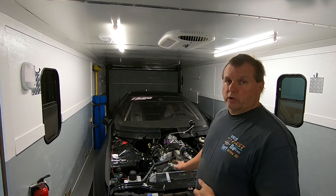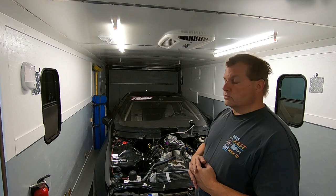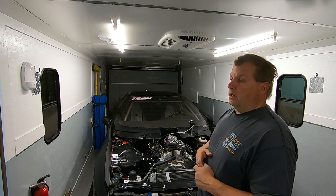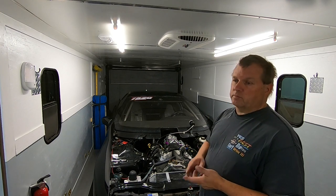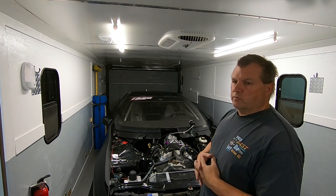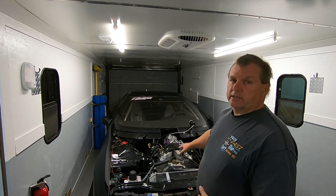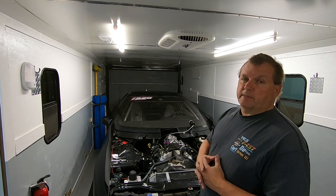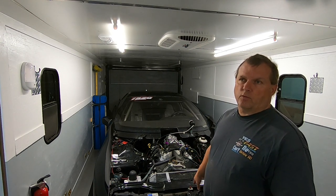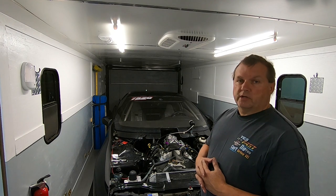Methanol is the way to go. So this carburetor, I'm going to go ahead and get rid of it — probably put it on the marketplace, go ahead and sell it and get some money back out of it and put it toward something else. It is an experiment, and in case anybody wanted to know: definitely if you want to go quicker, in my opinion, go with methanol. Yes, it's a little bit more expensive to run. If you want a cheap way to run the car and get really good gas mileage on the street, get a gas car by all means. The only good thing about the gas is I don't use that much gas — four passes and I didn't have to touch the front tank at all. The tank's about four, four and a half gallons in the front. Methanol, every two passes I have to put gas in that sucker.